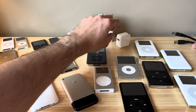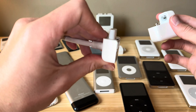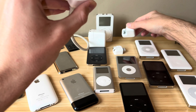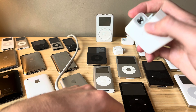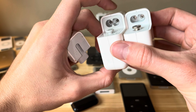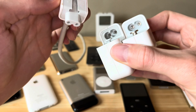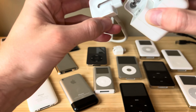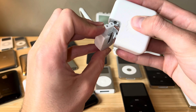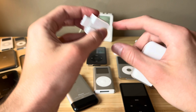I want to show you something else. You've seen how these come off and you can connect an extension cable - that extension cable looks like this. You just snap it in like that and you've got an extender on your charger. The Firewire does the same thing, but it's a little different. If we pop that off, you can look down here. Notice how this has a little tooth on top and a tooth on bottom. Compare that to the USB one, where it only has a little tooth on top. That means this connector will only fit inside the USB version - it does not fit on the Firewire, because there is not an extra slot for that tooth to go in. There's only room on the top; there's no slit on the bottom. So it does not work. You have to have a special power extender to work with an old Firewire brick.